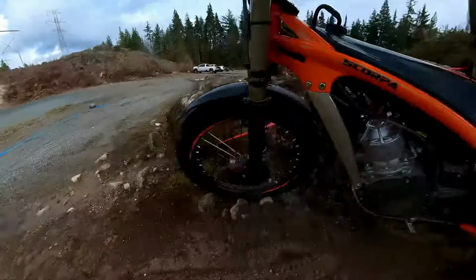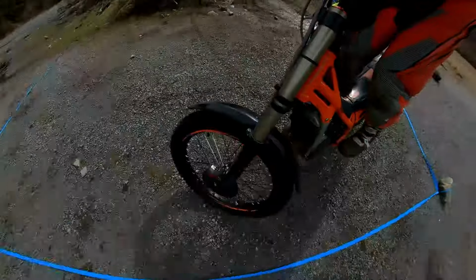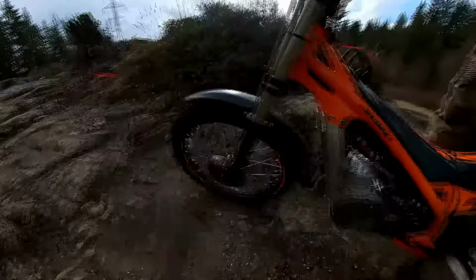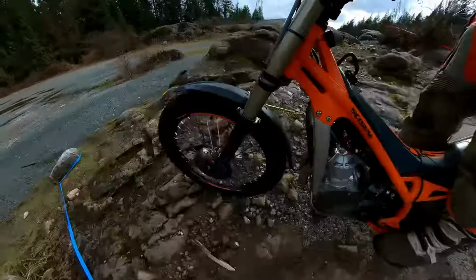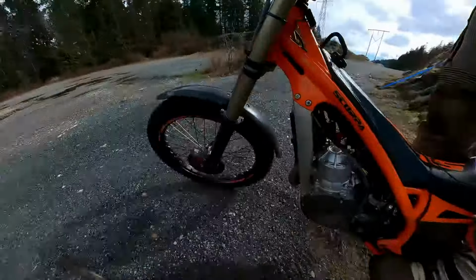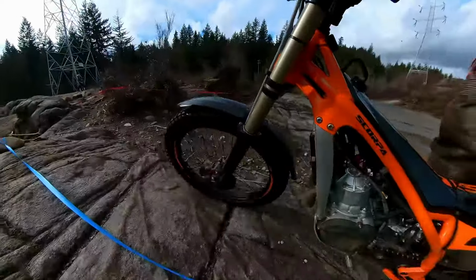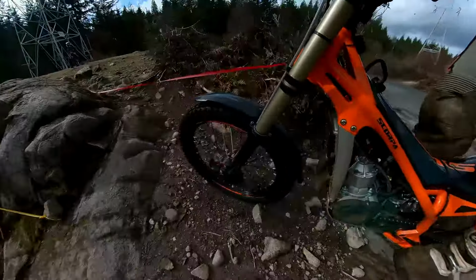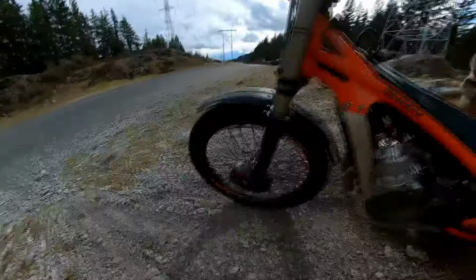What I'm gonna try to do is, I've got a heavier duty spring at home for the front and back, and as a test, maybe for a different video, I will do a spring upgrade for my weight. What I did find in the past though, putting those heavier springs in my TRS, is that it didn't really make the bike feel that much better. It would help you on big drops or square edges, it totally rolls out way better, but you've lost that compliance on the front end. You've lost that traction, which is important.